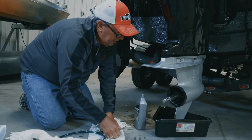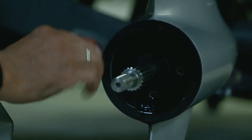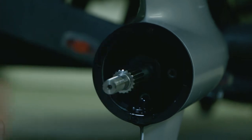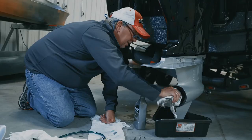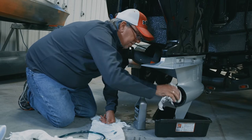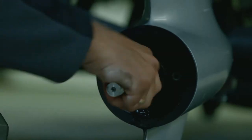There are a couple of things you need to do while the oil drains. Check the prop shaft and make sure everything's good on it — make sure there's no line that's been wrapped up around the prop shaft, because that will cause a problem. Then I like to clean it up from any exhaust residue that's been on there, so when you get it nice and clean you get a good visual inspection to make sure everything's been wearing appropriately on the hub assembly kit.